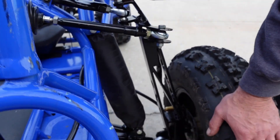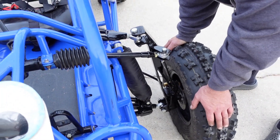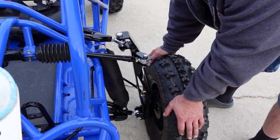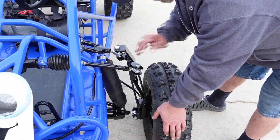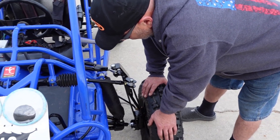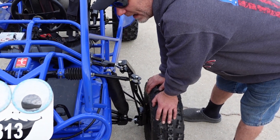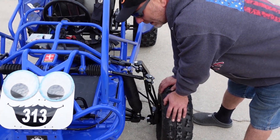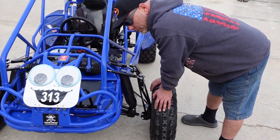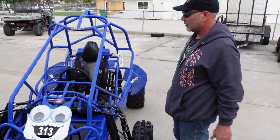The other thing I had in mind was mounting the heim joints with one vertically and one horizontally — to give it as much articulation as possible while allowing it to turn. I'd never tried taking a heim joint one way and putting the upper one different from the lower, so this was a complete experiment. So far the buggy is fast, handles great especially for a strut buggy, and Scott's really happy with it.